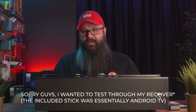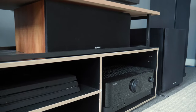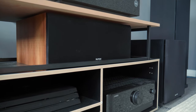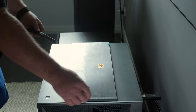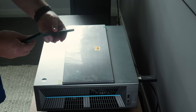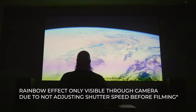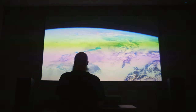For the demo I'm doing here, I won't be using the included BenQ TV dongle, as I have my Apple TV 4K set up, and all I needed to do is plug in the HDMI and power cable and I'm ready to go. I did test fit the BenQ dongle just to see how it worked, but I was more interested to see how it performed with my current 5.2 channel speaker configuration while watching movies and TV shows, because this is marketed as a home theater projector and the two built-in speakers just weren't going to cut it. After peeling back the two rubber protectors, when you power on, there is a panel at the top which opens to reveal the lens, and also two motion sensors which snap the picture off if they detect any movement in front. I was able to get through the whole calibration process without triggering the sensor, which means I must be getting good at calibrating these ultra-short throw projectors.